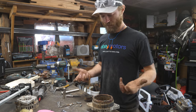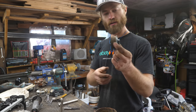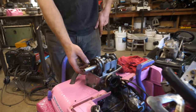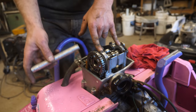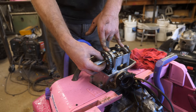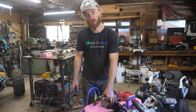First step is driving the supercharger. I've got the valve cover off and my plan is to make an extension of the camshaft that drives a serpentine pulley to drive the supercharger. The camshaft is completely hollow, so I can machine a shaft that fits nice and snug inside there, then make a plate that bolts on with the cam bolts to hold it sturdy, run the pulley on the outside as close as possible to the valve cover surface, and add a seal to keep it from leaking oil.